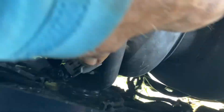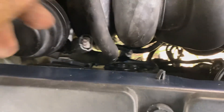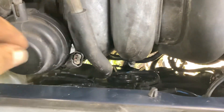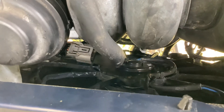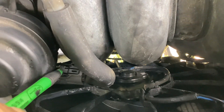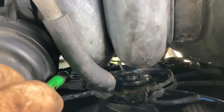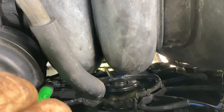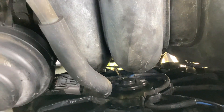Car manufacturers make the cable just long enough to reach its position — there's no extra slack, every millimeter of copper wire is accounted for. You can see the little push tab here — it goes into that black connector. To push it in is easy, you don't have to push the connector; it'll click itself. But to get it out, you push this little tab and pull — it unlocks a little notch in the middle of that hole. Push down on the little tab and pull — it requires two hands.